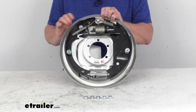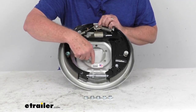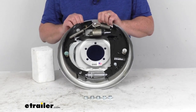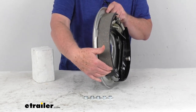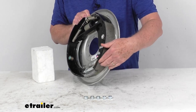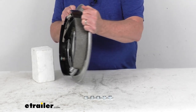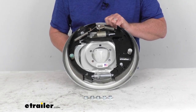This is a right hand passenger side brake assembly. When you get a new one, there'll be a sticker on it that says right hand or left hand — that's the easiest way to tell. But if that sticker isn't there, a tip to identify it by looking is to check the size of the brake lining on each shoe. This shoe has a longer pad, and this one has a shorter pad. The shorter shoe is the primary shoe, and that primary shoe always faces the front of the trailer. So if it faces the front, you can see it goes on the right hand or passenger side — that's the best way to tell if it's a right or left hand assembly.